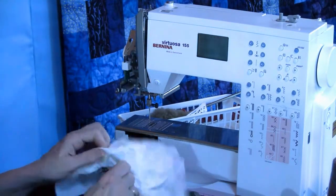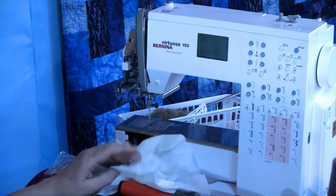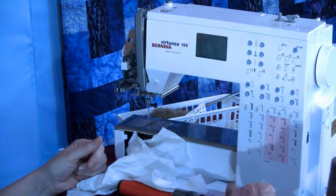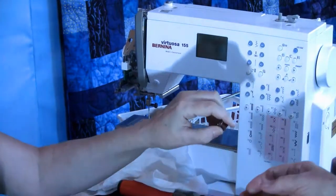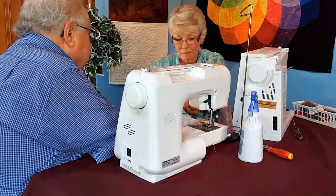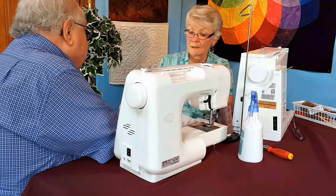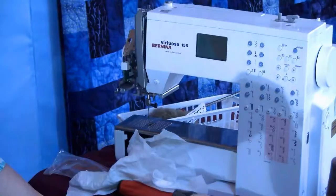Touch and clean and wipe down everything you take off your machine, and you are just eliminating potential problems. Okay. The last time when I worked with you that day, you picked up this bobbin case. Tell me about that again, because you had detected something underneath this where there's a spring. You remember that? Yeah.